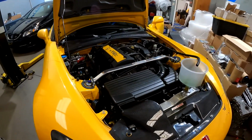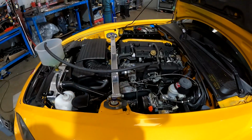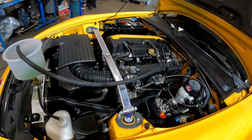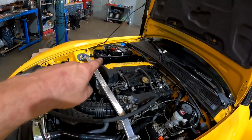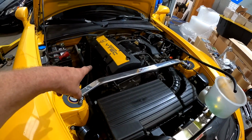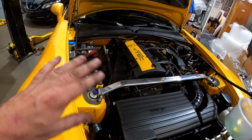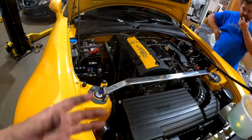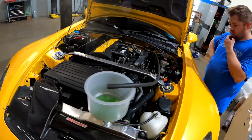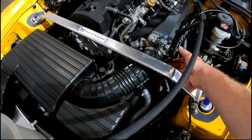Little timing chain. Again, we preset the timing chain, so it takes a second to build oil pressure and quiet up. Sounds good. We'll probably end up with a little bit of smoke over there in a minute after us handling the manifold, before we put the heat shield on. There it goes. Most people freak out when they see that for the first time, and then once you explain what's going on, you know, of course you can clean it all off with alcohol before you put the heat shield on. It'll burn off in a second. Nice. You put the heat shield on too? I didn't yet, no. No stumble. It sounds nice. It's responsive.